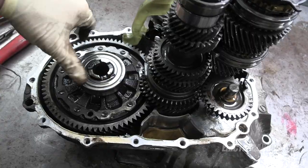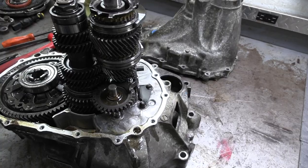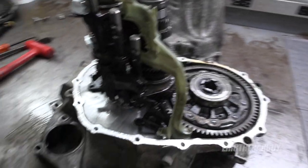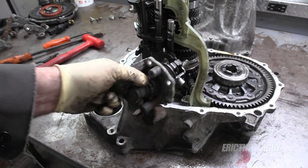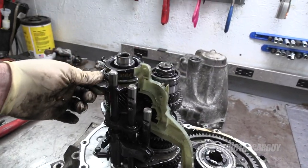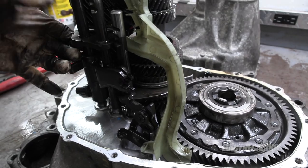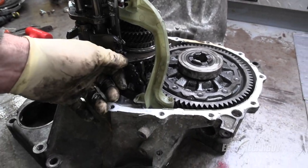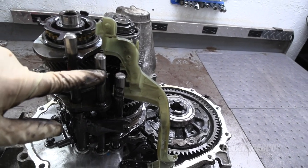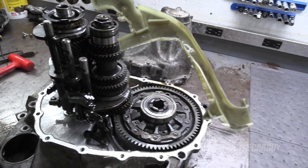There's where the axles go in. The shifter connects right in here and moves these levers around — those levers select the different gears. The little detent balls on the outside fit into these detents to keep it in gear. If it doesn't stay in gear, check those detents. The shifter assembly comes right out like that.